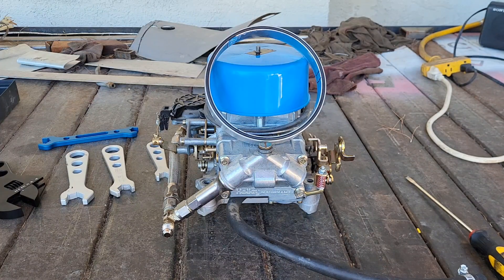Well, this is a weird problem. The carburetor is getting fuel from the pump — that's all good, bowls are full — but it won't give any to the motor. The accelerator pump's not working, it's not shooting through the nozzles, it's not getting wet. Put in Berryman's B12 — great product — fires up on it, as soon as it's over it stops. That's what we're doing today, trying to figure out what we've got going. I don't understand it either, because this is a brand new carburetor — it doesn't have 100 miles on it — but it sat, according to what the guy tells me.